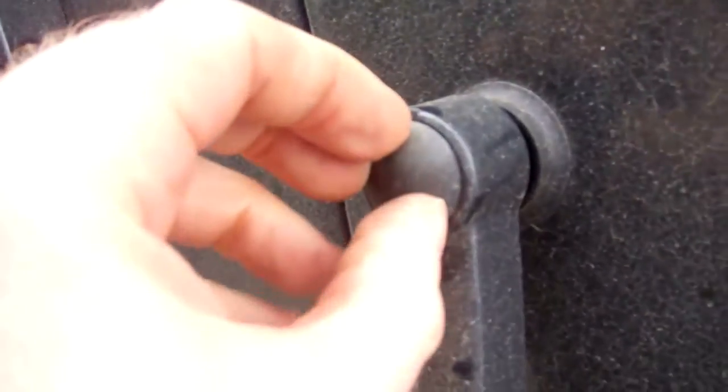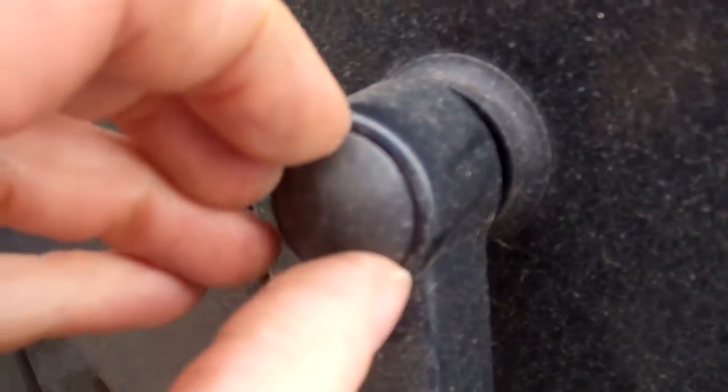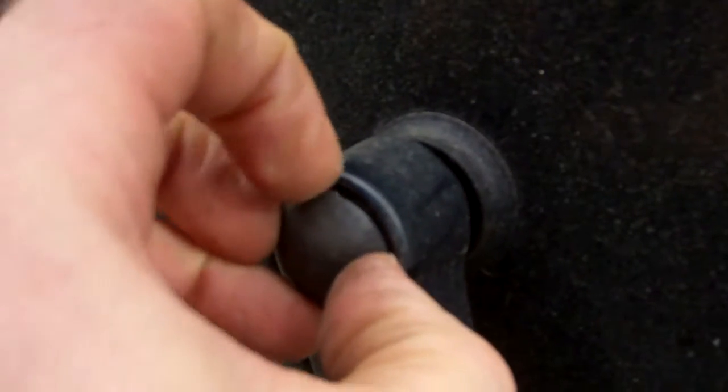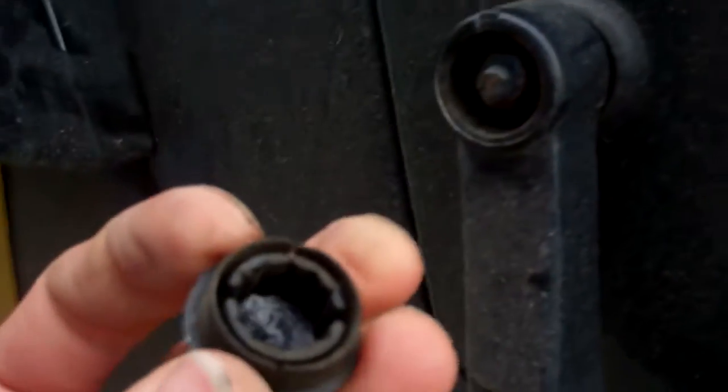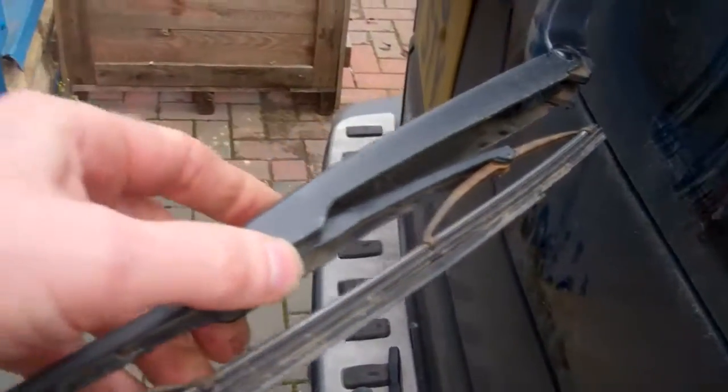We've smartened up the back of the car and we'd also replace the cap, so there are actually three bits involved here. You've got this little plastic cap here — there's a little screwdriver slot at the top you can see — you can get in there and pull it out, sometimes with your finger. Often these are missing and they fade. So there's the cap, the arm itself, and then the wiper blade which is this little bit that wobbles about here. The wiper blade unclips.